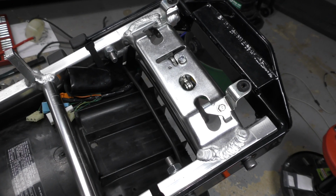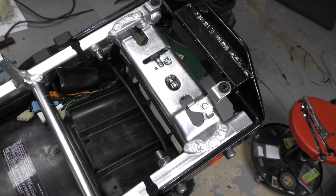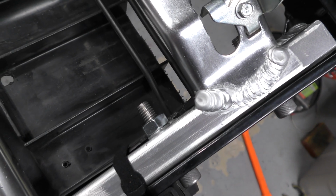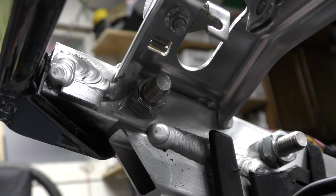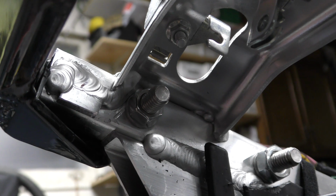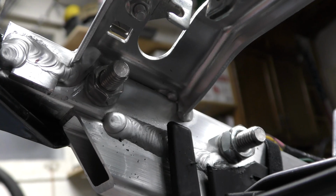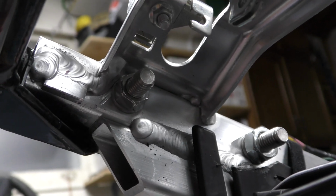The only reason for that is just so if this latch ever comes loose, your seat doesn't fly out on accident. For the nuts and bolts on the 1 o'clock plate, these 2 nuts are M10 1.5, and then I have split lock washers in there as well. For some reason, these are smaller nuts that use a 9/16 wrench, but it somehow still threads onto the M10 bolt. Those bigger nuts on the front use a 17mm wrench, but same setup, split lock washer, nut, bolt straight through.